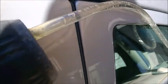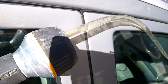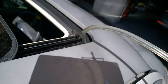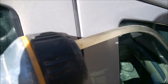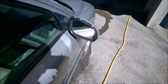You may want to try a slow, weak jet first, because if your drain is clogged it will just spray water back out. Start with a slow jet. I know mine are already unclogged and clear. Once you can see the water exiting under the car, you know it's clear — just give it a good jet with some pressure for two or three seconds. Start slowly because you don't want it to leak inside the car.